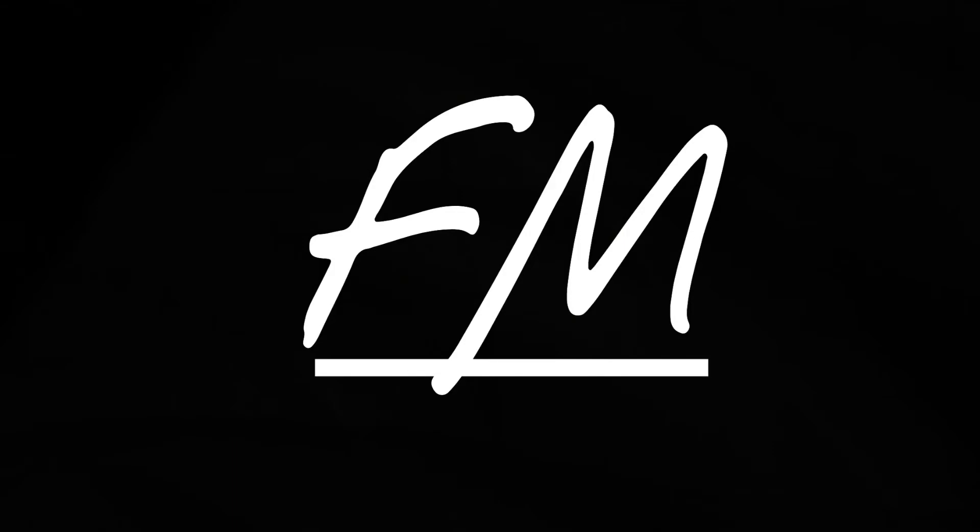There are the final results — super clean. Now you guys know how to fix curb rash wheels for cheap: clean the surface, tape it up, spray in light layers starting light then going heavy, finish with two to three clear coats, and don't forget to sand first depending on how deep the curb rash is — higher grit number means less aggressive sandpaper. Thank you guys very much for watching. See you in the next one — maybe an installation video. Deuces.